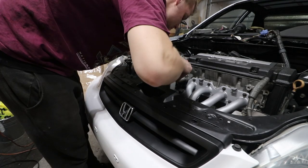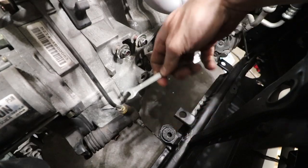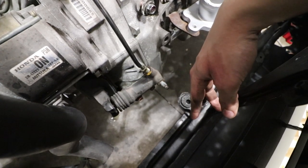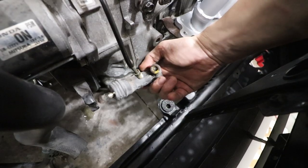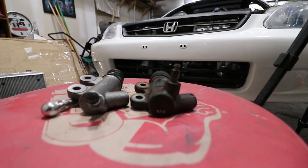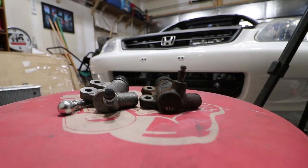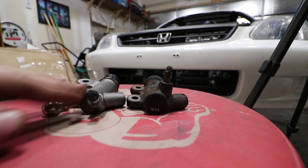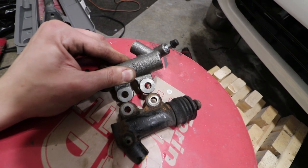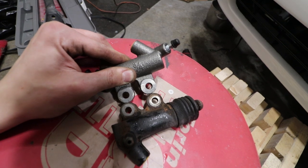First I just have to take the radiator back out. So we're going to loosen up this nut right here to loosen off the clutch pipe from the slave cylinder. 10 mil. Next we'll need to remove the two bottom 12 mil bolts. Just go bit by bit back and forth until you get that off. Alright so here are the two slave cylinders, one from the Prelude and one from the Integra. This is the difference in height on them. There's quite a difference when it comes to the Integra — a lot more flat and should give us plenty of clearance. One thing that is different though is the mounting holes are a lot closer together so we actually have to modify the Integra slave cylinder by drilling out the hole a little wider so it can fit on the H22 engine.